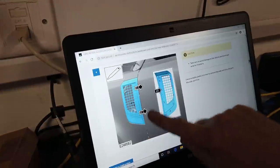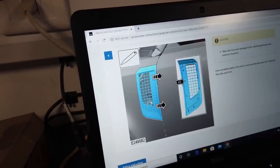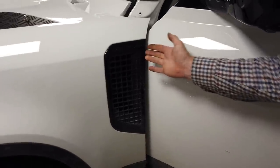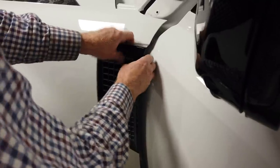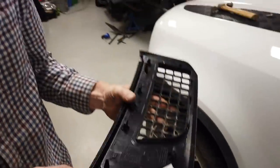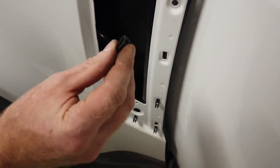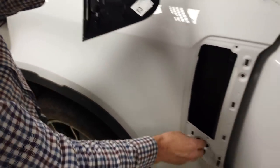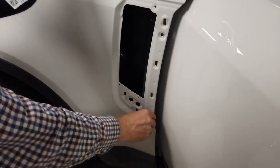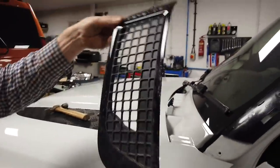Now they're telling us we need to take out this side vent. Although the arrow looks like it moves to the right, it's actually coming towards us, and it's got nine little clips. Let's be brutal and rip this out. If we open the door we can get a grip — just don't trap your fingers. It's left all the clips in the door and the wing. We put those all back on. One, two, three — yeah, we haven't lost any. That's how to take out the side vent on your Defender.